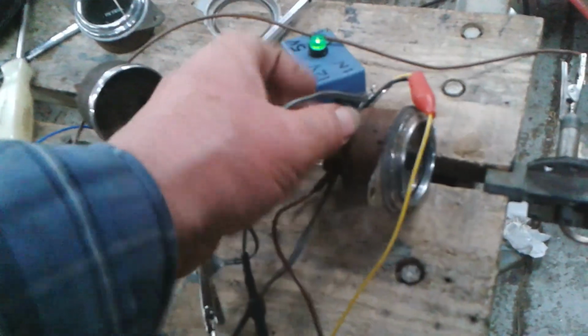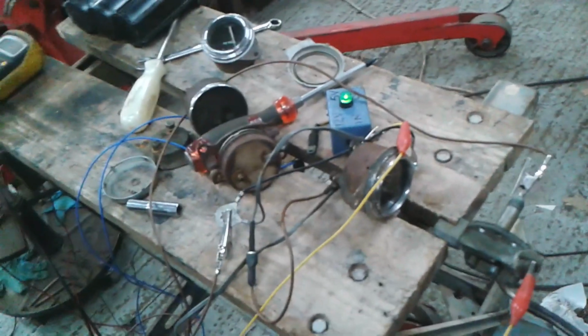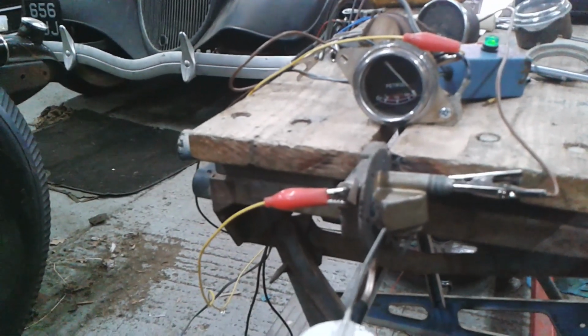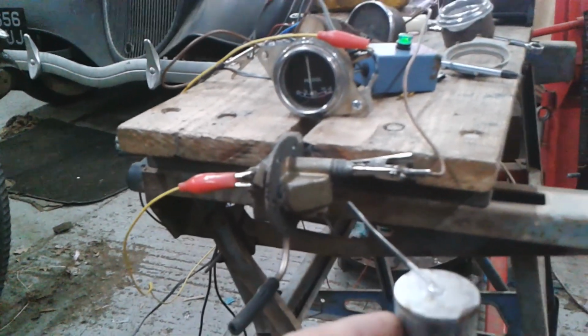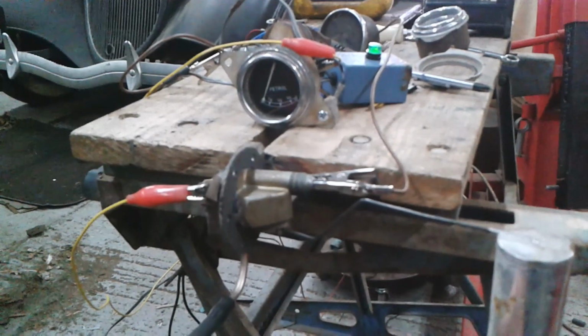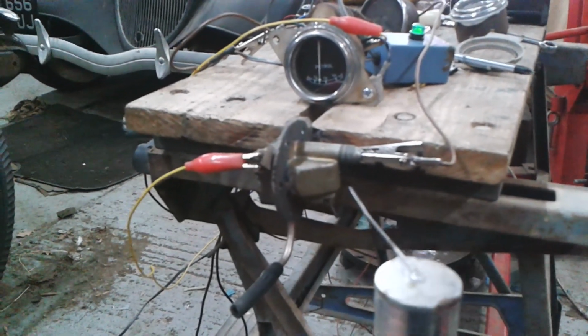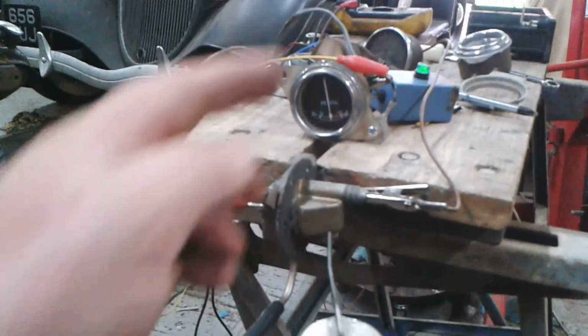I've got this little 12 volt unit that I salvaged from a skip. It says 12 volts in, 5 volts out. And I've got it running off a 12 volt battery, because what I found was that trying to run a makeshift voltage regulator off an old-fashioned battery charger doesn't particularly work very well, but this appears to be working okay. It's working on 5 volts.